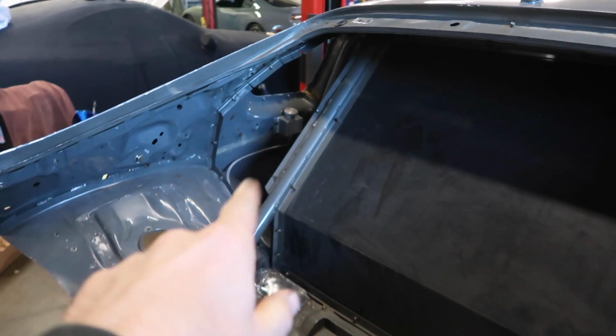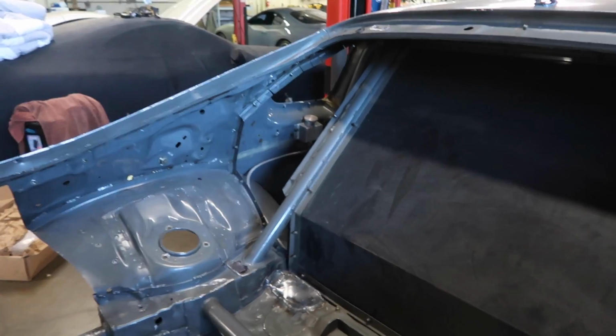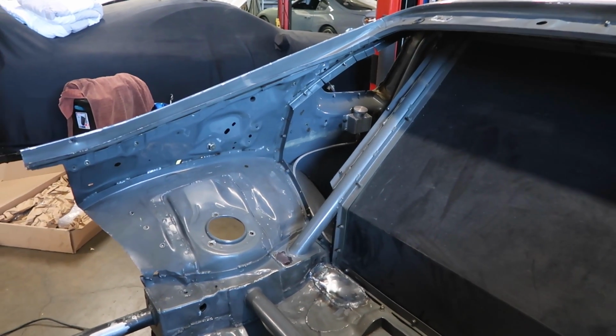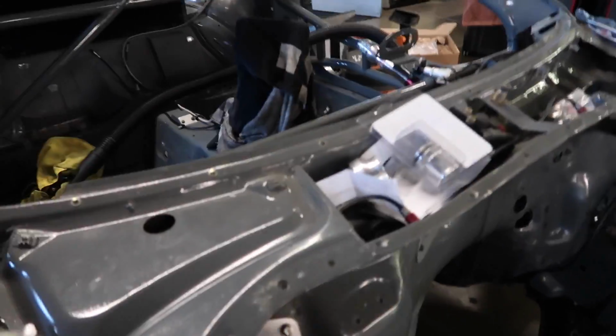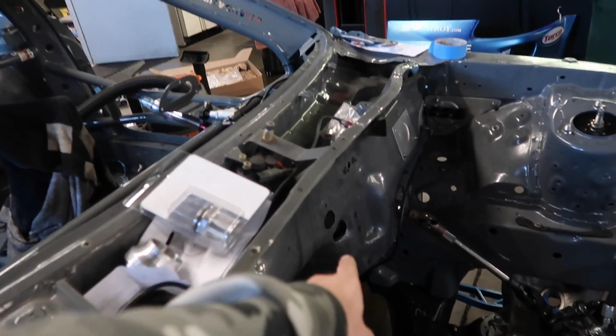So we have to make another one of those sides because it had some holes where we had slipped wiring through. But what we're gonna do is put a bulkhead fitting there so that it's removed by the back half of the chassis harness. The front middle section will be in the cab. There'll be another bulkhead here where the front one comes out. We'll have a fat bulkhead down there.